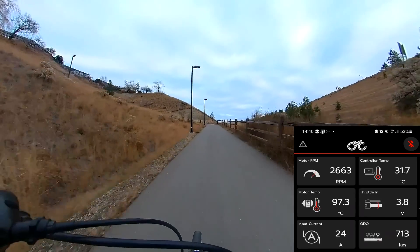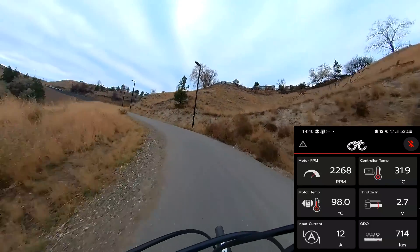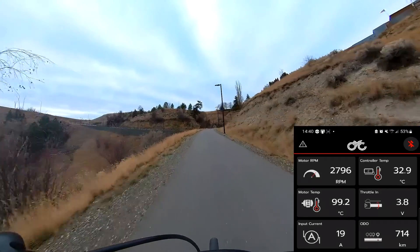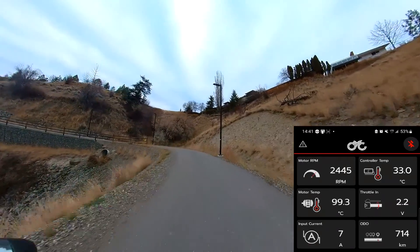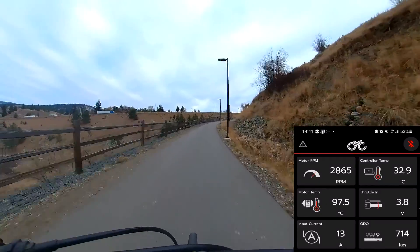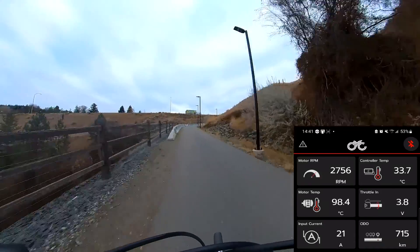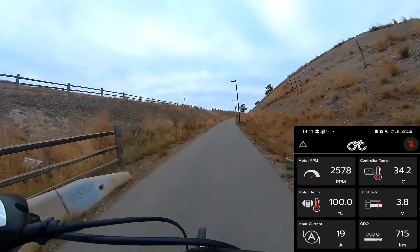Even running it at its rated 750 watts, the motor will build heat quite fast, and if you run it unrestricted at higher power, even more so — a quick burst of pedalling on the flat will see the internal temperature shoot up. In colder conditions like I'm running it here, unrestricted, I was able to get it to throttle pretty easily. The motor then sits at that point for long periods of time and it's difficult for it to cool down effectively, especially on long hills, because of the encased nature of the motor and the narrow heat paths. CYC do use high quality magnets apparently capable of withstanding 140 degrees C, but the issues I don't believe are failing magnets — it's failing electronics, and in my case it was the Hall sensors.